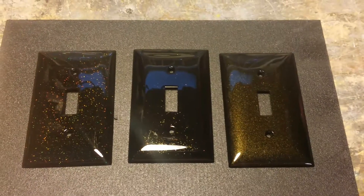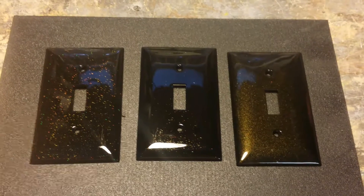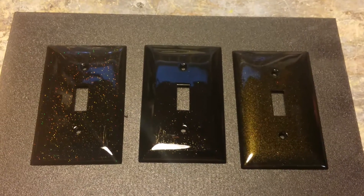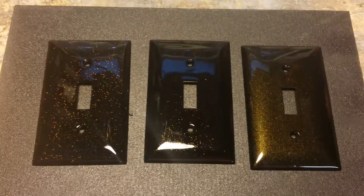So let me go over these real quick. All of these will be a three-stage paint, which is going to be your base coat, your mid coat of pearl or flake, and then your top coat of clear, and of course your normal cut, buff, and polish.